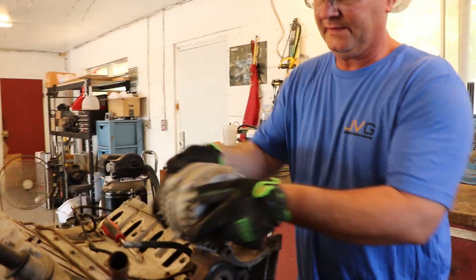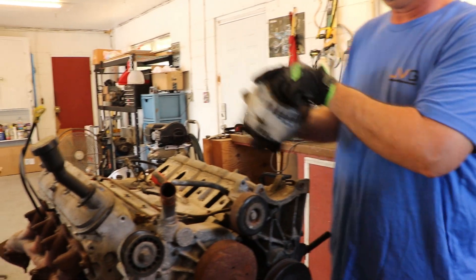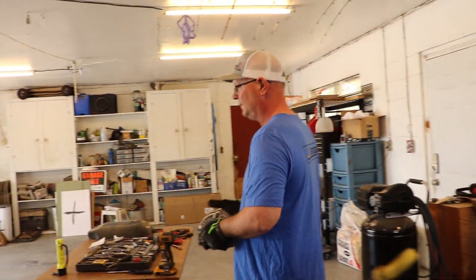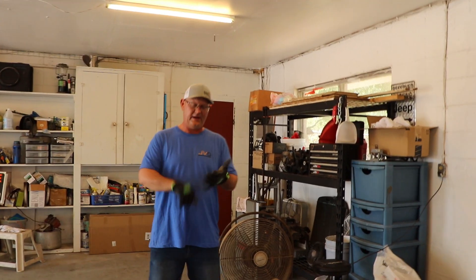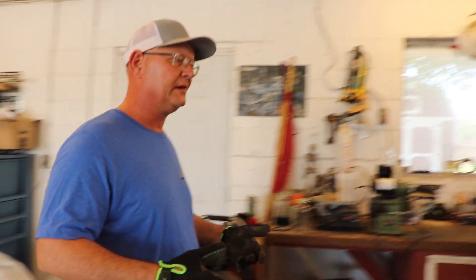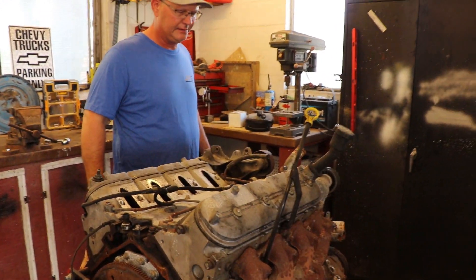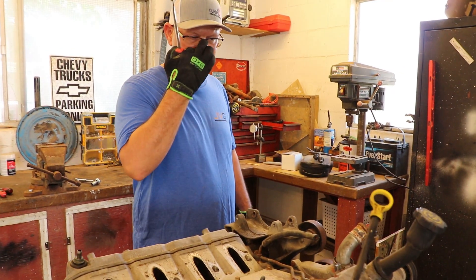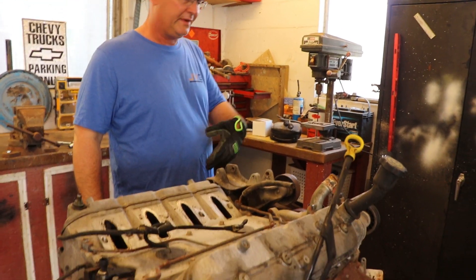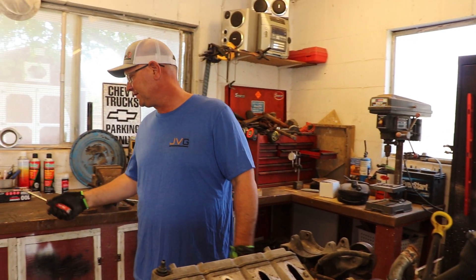With these motors, when you put an electric water pump and take off the AC and all that, on the engine dyno they're pushing about 350. When they test them at the factory, they're testing with air conditioning on and all accessories on to get your SAE horsepower rating. So these motors in stock form, if you strip them down to nothing, they make 350 horsepower — it just shows you how much it takes to drive all your accessories.